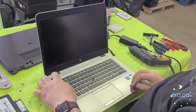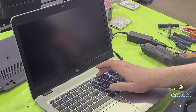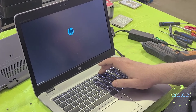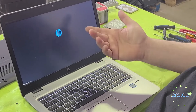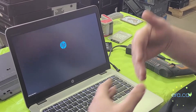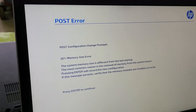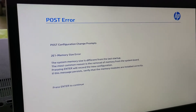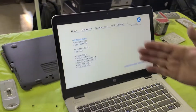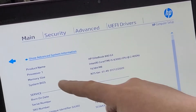We're just going to make sure it works with the RAM we put in there before we do anything else — press F10 to go into the BIOS. There's no beep now, which means the RAM was registered successfully. We get a prompt that the amount of memory has changed from last time this machine was powered on. We acknowledge that, and the BIOS shows 16 GB of RAM.